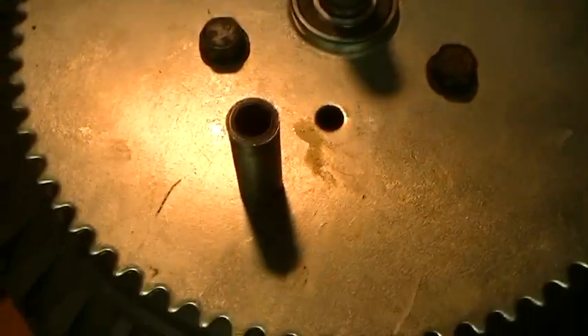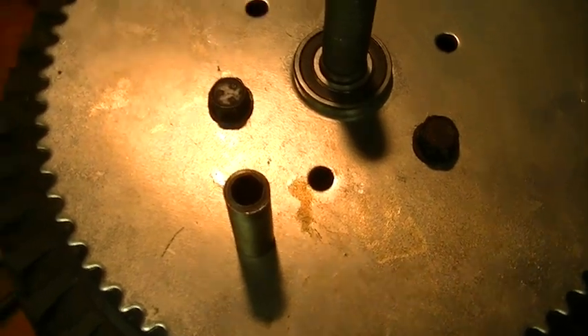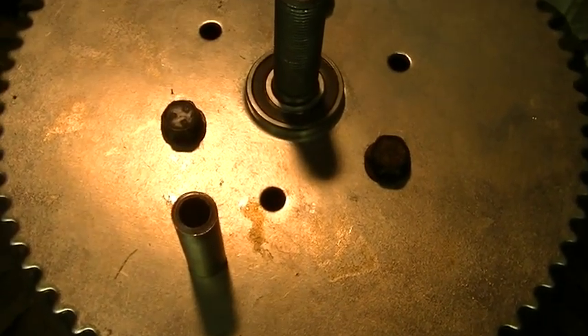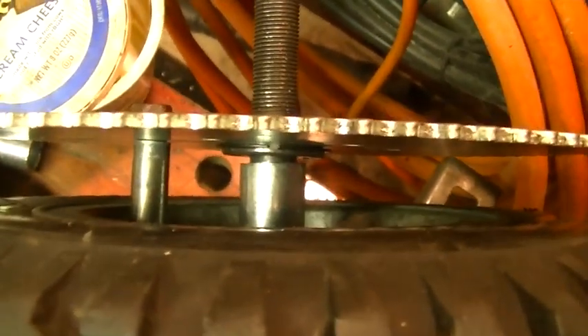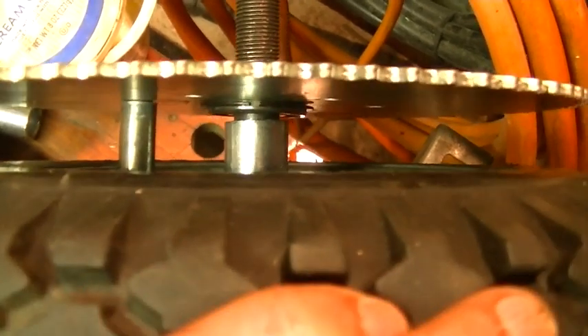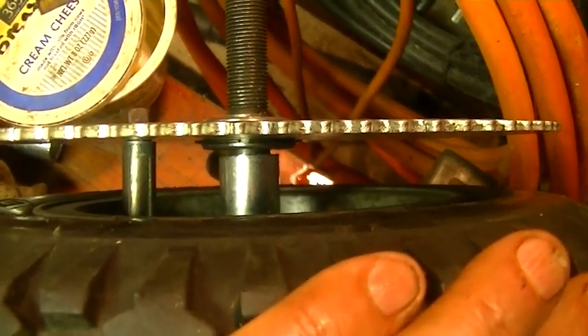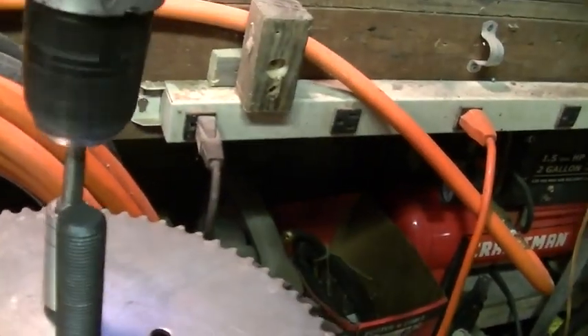How am I going to figure out if this one's right? I'm going to take those three bolts out, put this on one of them, and see how it feels. It looks like it's a little bit long compared to the spacer on the axle. It's only one bolt in, but let's put the other two in and see if we can get it flatter. I sucked it down on that side - that's not right. Back off on them a little bit. It's kind of hard to get it level when it's incorrect.